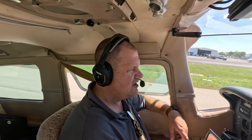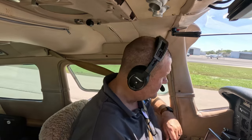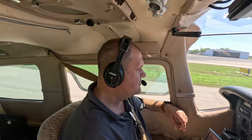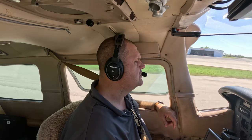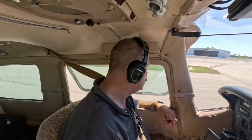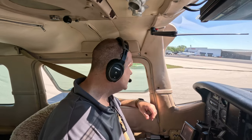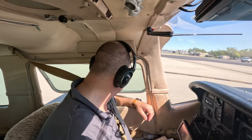Okay, that was a good flight. Everything looked good except that number 6 cylinder head temperature. But we'll have the guys take a look at that. We already noticed that there was a little bit of chafing on one of those wires. I think that was the EGT that we'd already looked at. It was kind of odd, that number 6. It's just giving us fits.